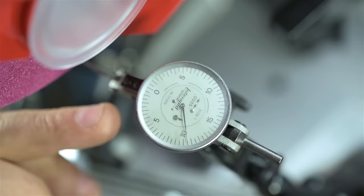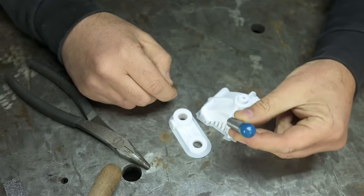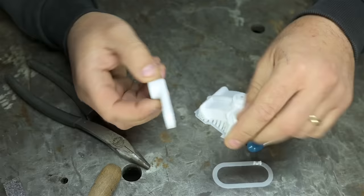Again, maybe not the end of the world for a chain grinder, and those dull spots would come out when you redress the wheel. They do recommend you dress this thing pretty often. But since it's a handheld dresser, you'll never get that out of round out. So I 3D printed a little jig. This will use a diamond nib from the surface grinder, if this works. I was going to machine this.